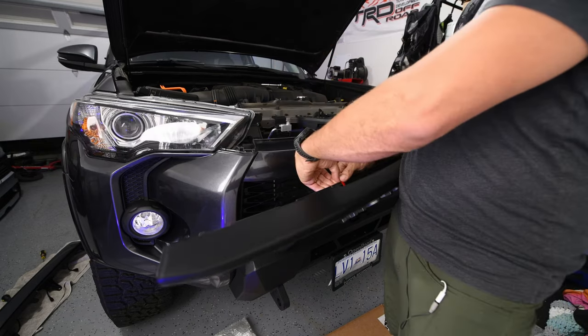Tuck the wire, then use a 10mm socket to remove the chassis ground bolt — that's where the ground ring terminal attaches. Slide it back on and tighten it down. The fuse panel cover may no longer fit due to the connector protruding, so store it in the glove compartment for now. Route the wires directly down from the grommet hole and tuck them into the carpet. All wiring is now complete.